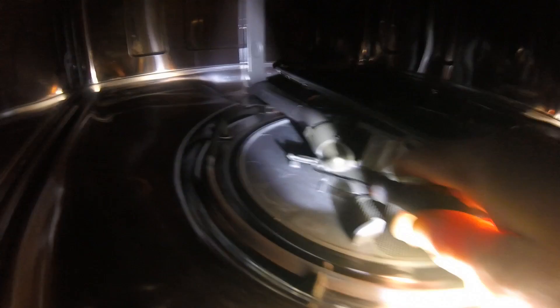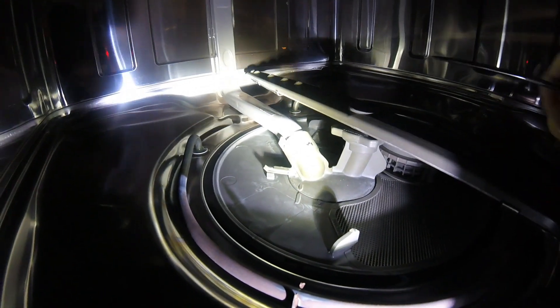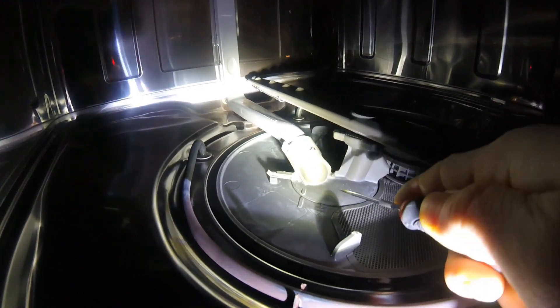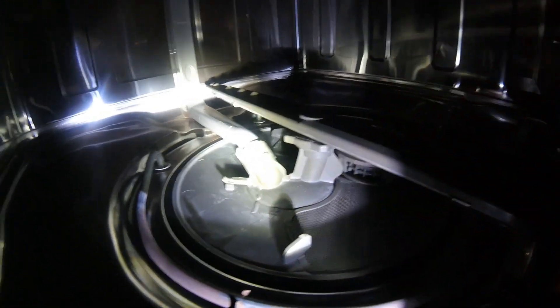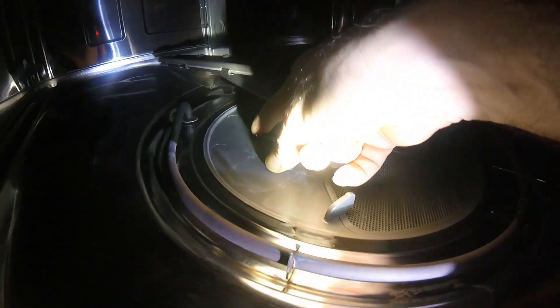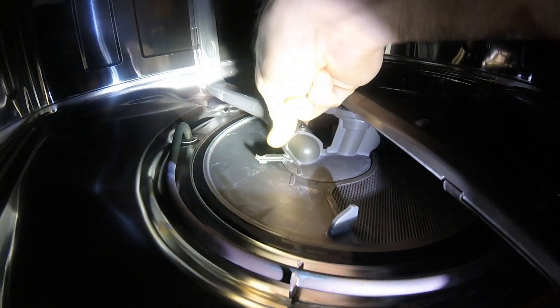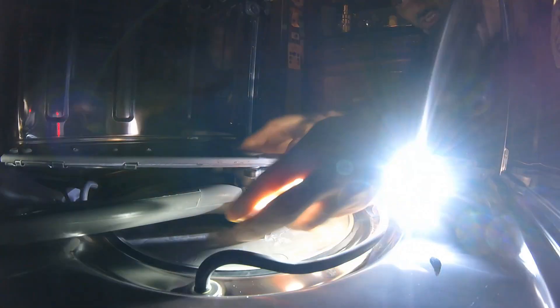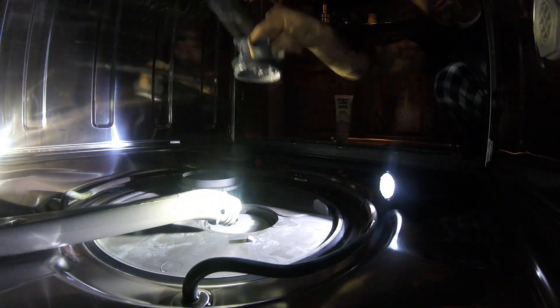This repair is fairly easy in the sense that most dishwashers will have a way to disengage this particular center piece. Once you remove that — this is the water diverter I was talking about — the water comes from underneath the motor, and then you have the bottom sprayer and the water can go up to the top sprayer. The way you open it is there should be some sort of latch here. You kind of unhook from the latch and simply rotate — see, there you go. A lot of these pieces will have flex in them, this back pipe, so as you rotate this, the back pipe will kind of give way. As I pull this out, don't pull on the latch — you don't want to break that. But you can pull on the center piece and it will come loose like this, and put it on the side.